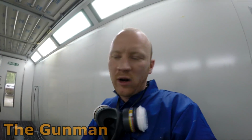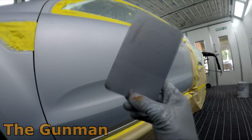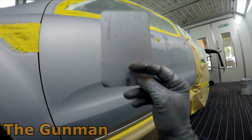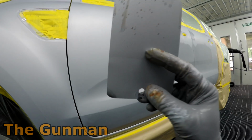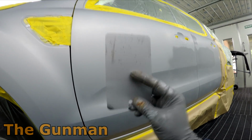around the edge. What it turned out to be is that, okay, that's well and good over your primed area. If you use, say, a light primer, whatever value shade they tell you to use, then the colour's going to be fine over that. But as soon as you've got your full coverage, it's going to darken up. So that's 1.5 coats. It was actually really light, so you can actually see through to the black there. Whereas there, with that extra couple of coats, the colour has darkened up, and that colour is fine.